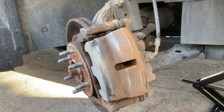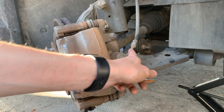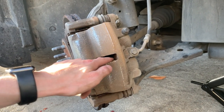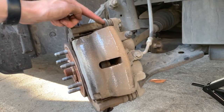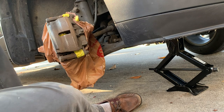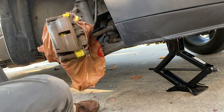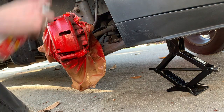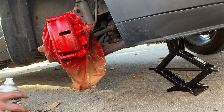So there we got it. What you want to do is put some tape over the hose coming out of the brake caliper, as well as the rubber pieces — there's one above and below — I've taped those as well. Then we just shake up the spray paint for about a minute. We've got our plastic bags underneath there — stretch it out, use the elasticity and put it underneath the brake caliper first to protect what's underneath.